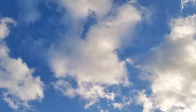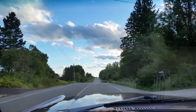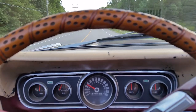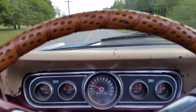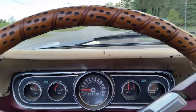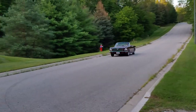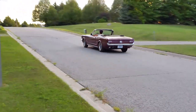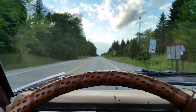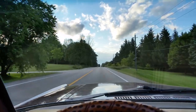I sure could get used to this. You Californians have it made. Everything's good — oil pressure is not registering right now just because the sensor is for a light switch rather than a gauge. Those bias-ply tires are chirping. Still gotta fix that exhaust leak. But all in all — what a cruiser.